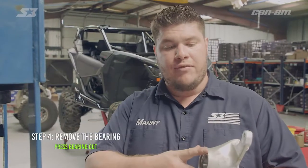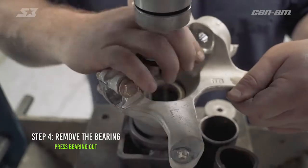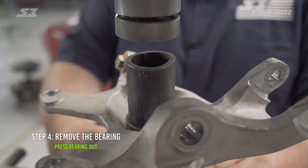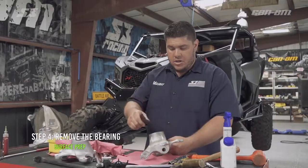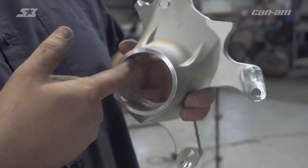Whatever you use needs to have a flat firm surface around this edge right here and it does need to make sure that it clears the bearing. Go ahead and make sure it's nice and level, center it up, and then go ahead and press the old bearing out. If you're trying to save your bearing, you need to be a little more careful what you put on this end to push the bearing out. If you're not worrying about it, then you go ahead and just push it out regularly. We got the old bearing out, now we need to prep this surface. Go ahead and make sure you get all the dirt and debris out of there and scuff up the faces, make sure they're all nice and clean. You can use a little bit of Scotch-Brite, just go ahead and get the surface polished up and get all the dirt off of there. A little bit of brake cleaner to get it off. Once you get your knuckle cleaned out, I like to put a little bit of green Loctite and just barely lightly smear it in so that the bearing has a good grip. This part's pretty important.